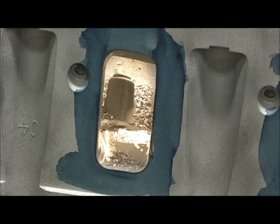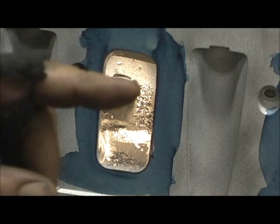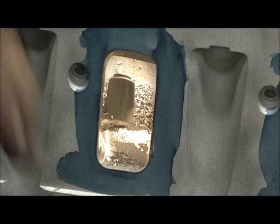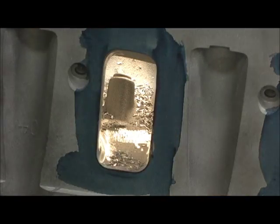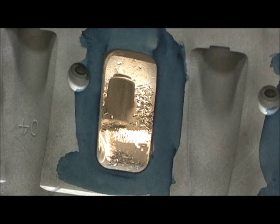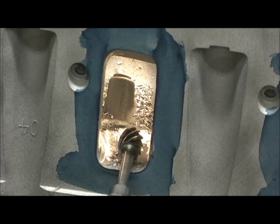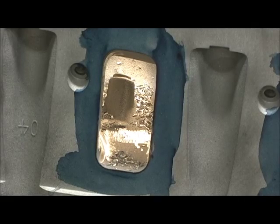On this bulge up here — this one — that's the one you've got to be careful with. You can pull it down and blend it, but you don't want to totally straighten it out with the roof. Although it would be nice to do that, the reason why is because if you turn the head upside down — which I'll show you in a minute — it's the spring perch. Leveling it flat might not bust through where you can see it, but it's going to weaken it, and if you go too much on it it could actually bust, and then you'd have a vacuum leak.